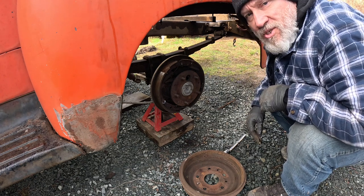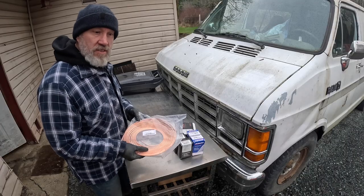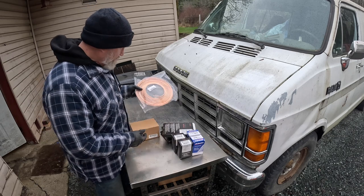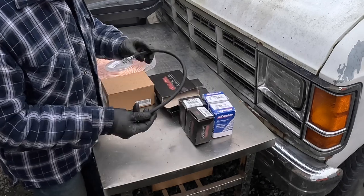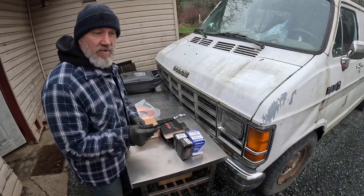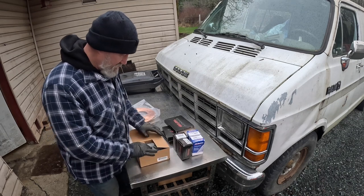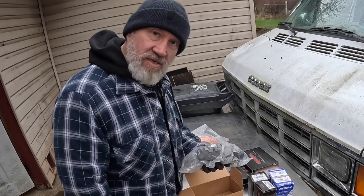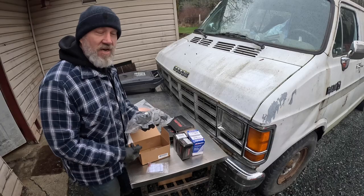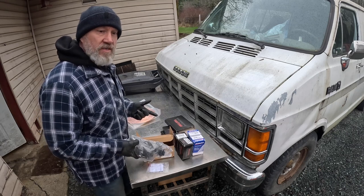Next I'm going to start taking the brakes apart, but first let me show you the parts I've bought. First off, some 3/16 inch brake tubing to replace that crusty rusty brake line running along the frame rail. New slave cylinders — front and rear, left and right. Soft lines: two for the front brakes, one from the hard line along the chassis to the differential that then splits in a Y to left and right brakes on the rear. And last but not least, a brand new master cylinder. I love that in this day and age you can still buy a brand new master cylinder for a truck that's 73 years old — this is not a rebuilt, this is brand new, I'm pretty sure it's a Dorman. The brakes in there actually do work, but I don't want to trust my life to 73-year-old components that have been sitting out in the weather for a long time.